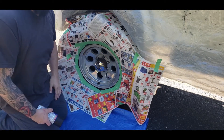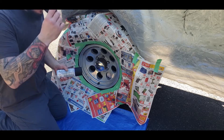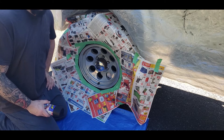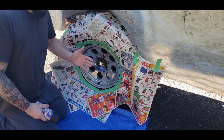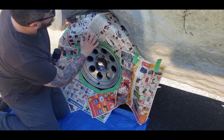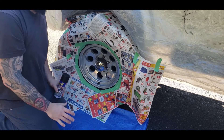It's like 13 degrees here — first nice day of spring. I've got this handy little spray adapter that sits on top of the can. You don't need to have one, but shake your can super good at the beginning and as you're using it. If you can, jack your car up and take your wheel off — it's so much easier to paint these wheels when they're laying down because you can see more of where you need to paint. I don't have my jack here today so we're going to paint them on the car. Just be really careful that you get every single spot. You have to work around from different angles, and that's why covering the vehicle up nicely is important because you'll be spraying upward potentially.